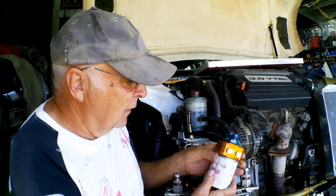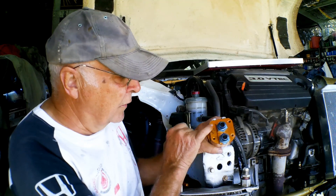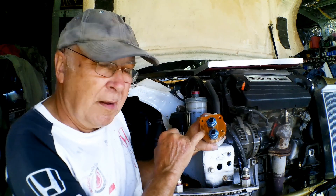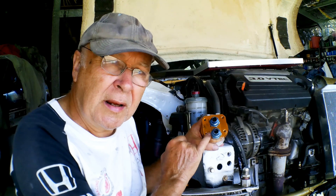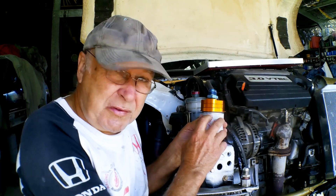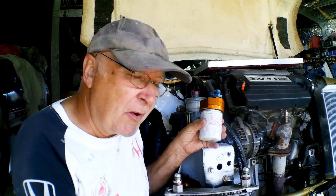I took this off and checked it. When I was putting the hoses on the car this time, I noticed that on the top of the block for the mounting of the remote oil filter, it wasn't marked in or out. I thought those hoses probably have to go around a particular way, but then I thought no, it doesn't really matter because an oil filter is just a pressurised container — it doesn't matter which way it goes through it. Well, it turns out I was completely wrong.